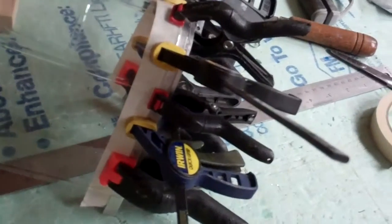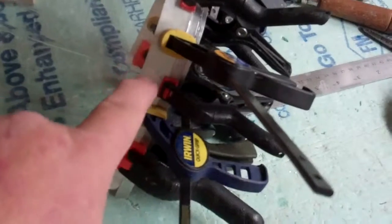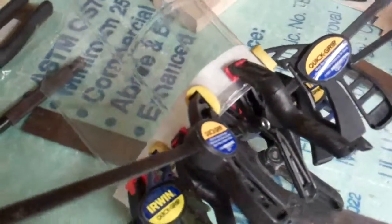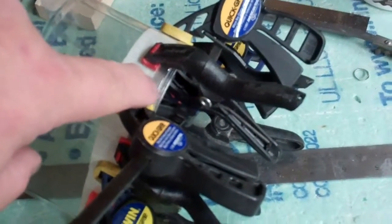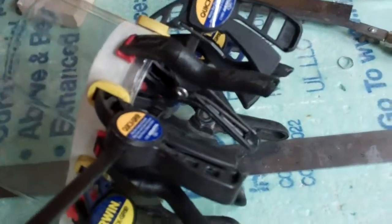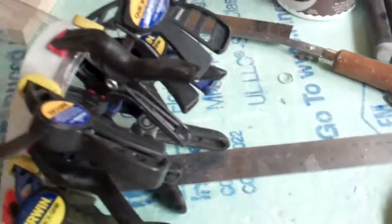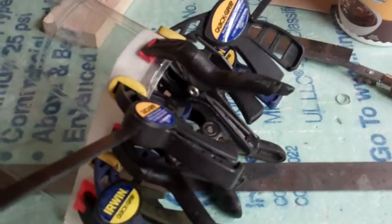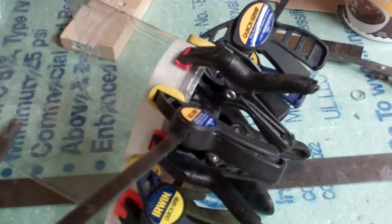Here you can see we have the stiffener glued in, and we're going to let it dry for a couple of hours. We used some masking tape to mark out where I want it to go and to keep the glue from getting onto the glass. Once I had the tape in there I smeared some silicone glue in it. You can see the aluminum stiffener strip is inside there, which also acts as your air dam. Then we just clamped it and we'll let that dry for a couple of hours. Once it's dry we will match up the screws to match up to the forward slider piece, so everything looks nice and neat and lined up when it's opening and closing.